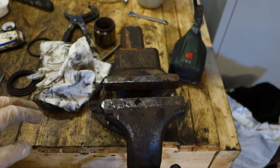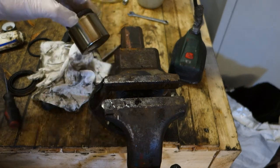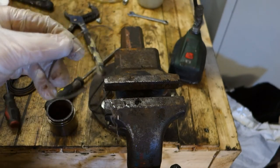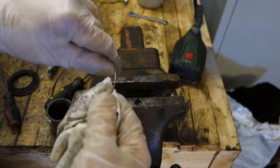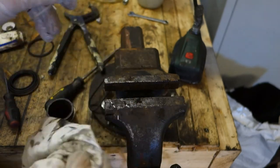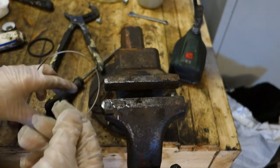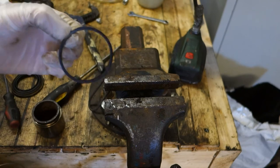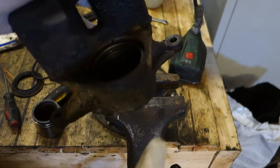Okay, and then I show you how to assemble this brake caliper and this brake piston. Because now all these parts are clean, and remember, all parts must be clean, like this metallic part, this gasket, boots, this locking pin, all must be clean. And use clean cotton cloth so that all items are clean, because it is a must. These pistons must be clean, this gasket must be clean, and this inner gasket, and especially that area, this cylinder must be clean.